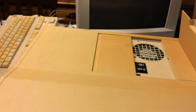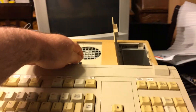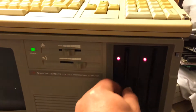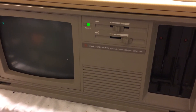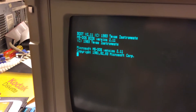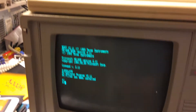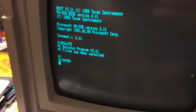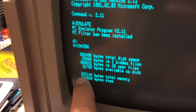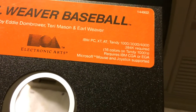You don't see too many of these - this is one of those luggable computers. There's really not much space. It takes a special MS-DOS 2.1 for the Texas Instrument. It's not PC compatible, but it kind of sort of is. Running check disk shows it's a 360K double-sided 40-track drive. We only have 256K of RAM, which is not even enough to run Tandy 1000 software - 384K is required.